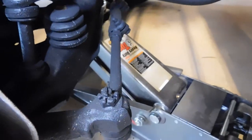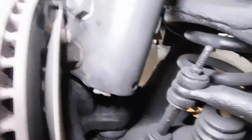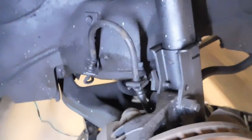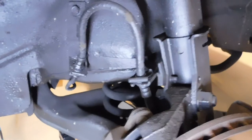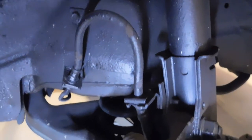Here's a closer look at the coil spring, the sway bar, the tie rod ends, and how the shock connects. You also want to make sure that your brake lines and everything are in good condition — just make sure nothing is broken, cracked, leaking, binding, or pinched.